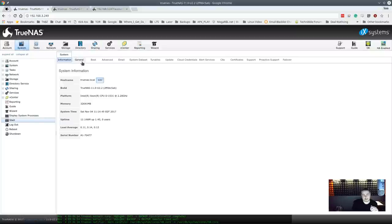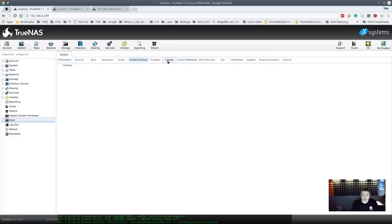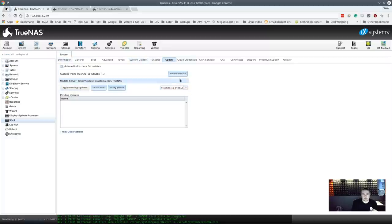What about updates? Updates for TrueNAS are less frequent than FreeNAS — they're very strongly tested and focused only on enterprise-level features, with stability being the priority. Because it's their own hardware, their engineers each have one of these in their lab, so they test everything thoroughly before sending you the update. When running an update with dual nodes, it updates the inactive node first, then switches back and forth. You can update each node with zero downtime.